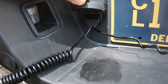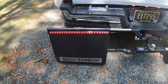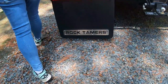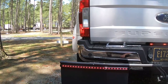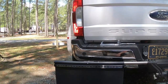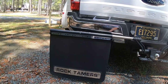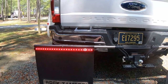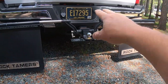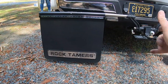Just plug and play as far as your 4-pin connector. Plug that in, fire up the truck, let's see if our lights work. Look at that — isn't that cool? Activate the turn signals. We're having technical difficulty — the turn signal is on the opposite sides. That means we've got to take those two wires and flip them. I had it wrong when I hooked it up — that turn signal was going off on the wrong side. So we've got to flip these two wires. Hopefully that solves the problem.